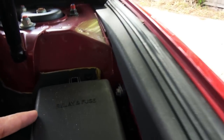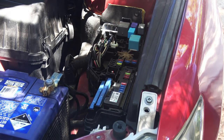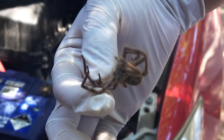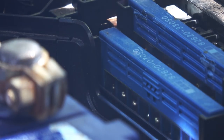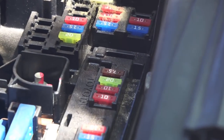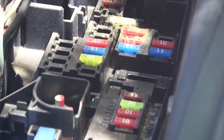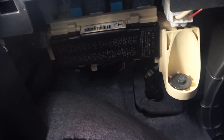Next, check the fuses and relays. In this car the fuse box is located right next to the battery. The fuse for the alternator in my car is one massive fuse — I don't even need to remove it to see if it's burned, as the metal inside is continuous so the fuse is okay. Do a thorough visual inspection of all relevant fuses, because sometimes one blown fuse for another electrical system can cause the alternator circuit to not work properly. Some cars have more than one fuse box.